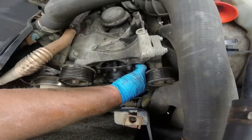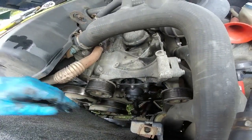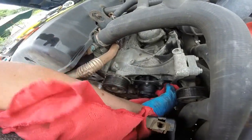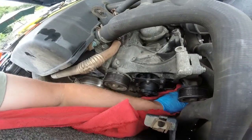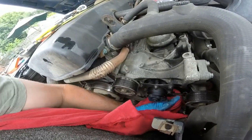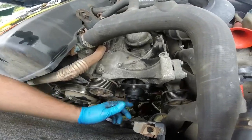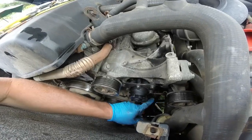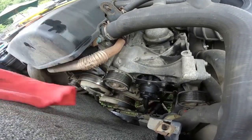As I'm doing it up this time, I haven't got to hold the other nut because it's going to be tightening up. And then what we'll do is put the pulley back on there, and that should be that side of it done. I hope it wasn't the pipe leaking, but like I said, the old one did feel a bit loose. This one feels a lot tighter. And it could be a lot of what sounds like engine noise I've had could have been a groany power steering pump. Like I said, it's probably been in it since new.